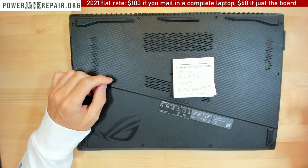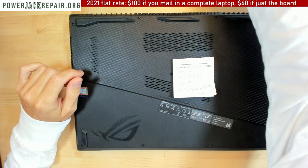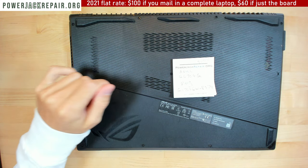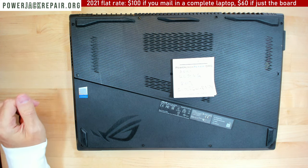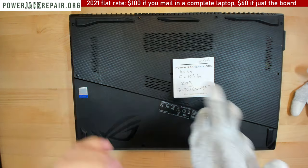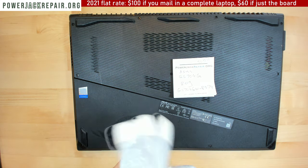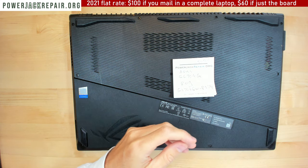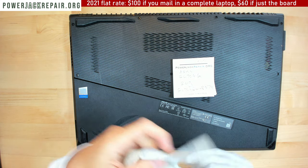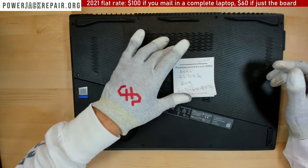Wiggle jiggle the plug. And that's all good. And while you wiggle it, I could still replace the jack and everything gonna work fine. But the problem happens is eventually it stops working. And that's the problem. The reason it stops working is that the motherboard usually gets shorted. And if the motherboard is shorted, then we're kind of out of luck.